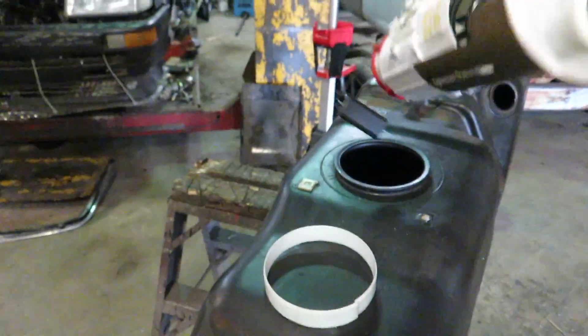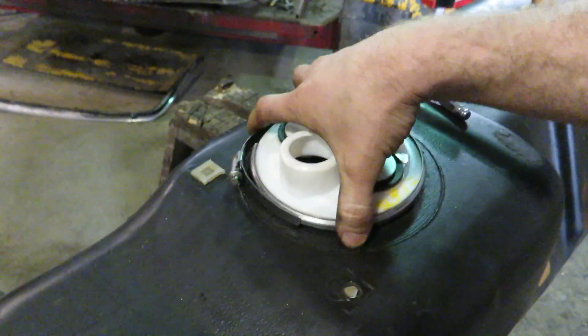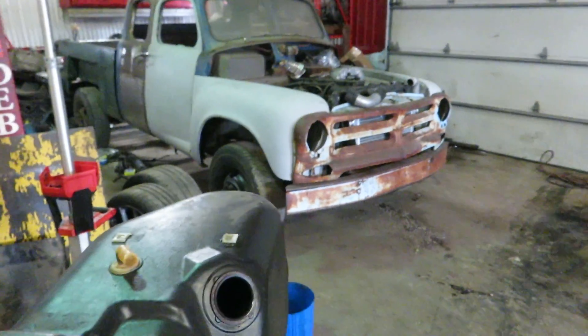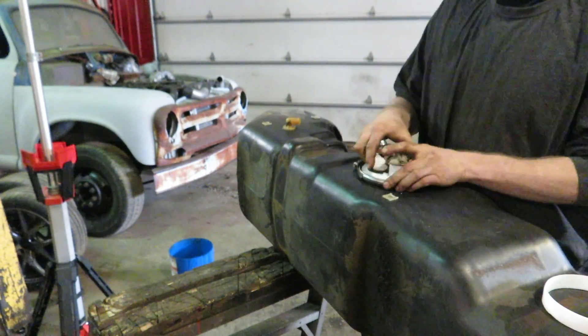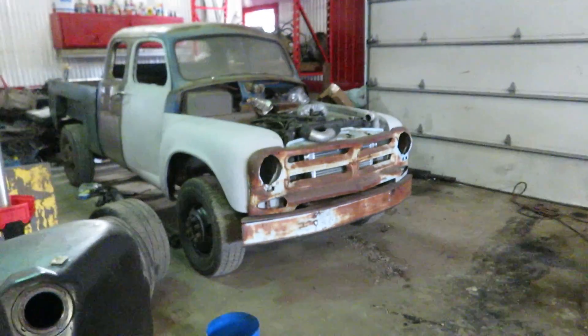That's already with a bit cut off, but that's what kind of seals it on the inside. Some of them have a seal on the bottom. This one also came with a giant opening at the top, so the customer has the old one and he's gonna see if it's got another one. When I pulled the other clamp off, that broke — and you cannot get first gen hose clamps to hold the sending unit in, but they're the same as the second gens. I highly recommend you do not use a first gen frame because the parts are so hard to come by. Grab it for the engine, toss the rest away, go get a nice frame, and just worry about your driveshaft and your mounts, keeping in mind you'd want something with a 3.73 rear end. Anyway, we're gonna tighten this up, throw the tank in there, run some new plastic lines to the engine, and find a place to mount the battery underneath.